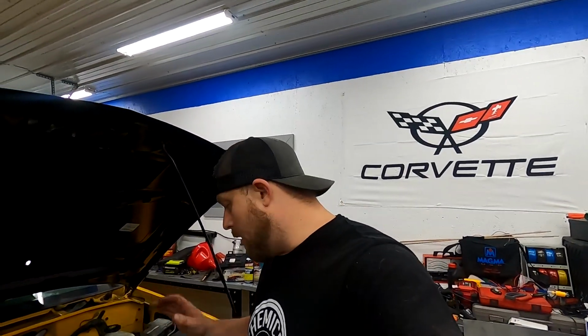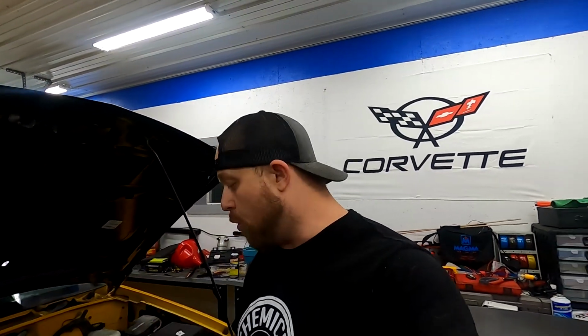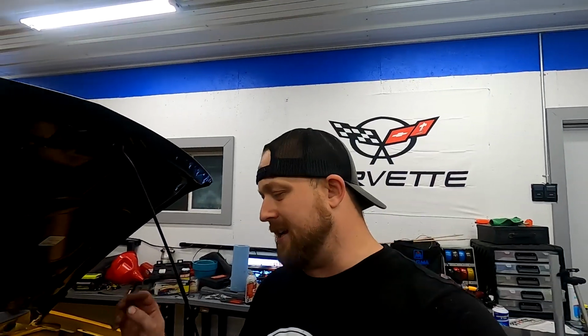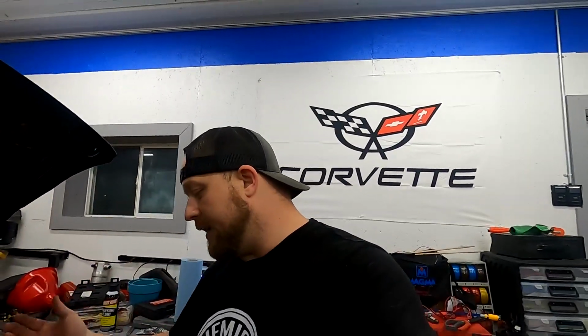So they're nice. All that's working. The belt may need slightly more tension, but it looks good. It's quiet. The power steering pump was bone dry, so I put some fluid in there. I got to obviously bleed that out a little bit. Everything's working well. It's not throwing any codes, but I can hear a slight miss, and I think that's the injectors. So let me think. Anything else, man? I mean, it's almost back together.